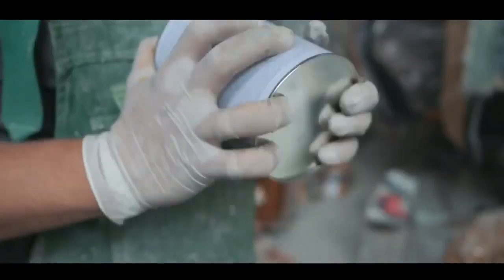We rub it with double epoxy acrylic primer, because liquid putty works worse than with epoxy primer that was covered previously. After that we will put a thin layer to delete bends and make our detail close to ideal.